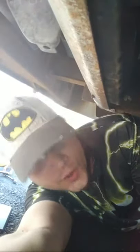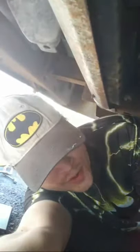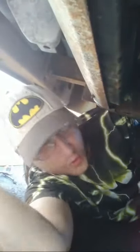I'm not going to take as long as I normally do. Normally what I will do is I will let her drain for close to a half an hour. Just let it drain and make sure I get out as much of the old oil as possible, but that's not truly as necessary as it sounds. That is just a Prince Magnum thing. I want as much fresh oil going in as possible. But do you have to do that? Not really. When it comes to a real, real light drip, you're fine. And that usually, depending on the thickness of your oil, takes about 5, maybe 10 minutes.